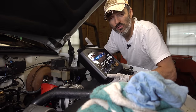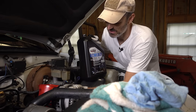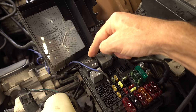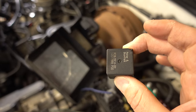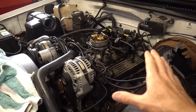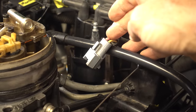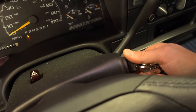The new oil filter and drain plug are back in place. I'm going to fill this thing up with oil — this 5.7-liter engine takes five quarts, and that's exactly what's in this jug. I'm also going to pull the fuel pump relay so that when I start it and give it a few revolutions, it's not going to be pumping fuel. Every single thing is back in order. The coil wire is disconnected, all the spark plugs are out and the plug wires are off. The whole purpose is just to give this thing a few revolutions to push out any fluid that may be in the cylinders. Here's hoping I put everything back together right — let's give it a few cranks.